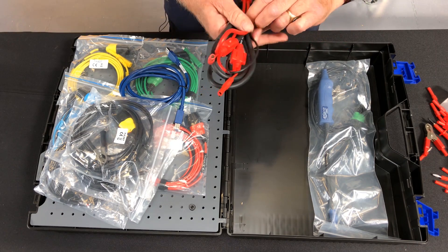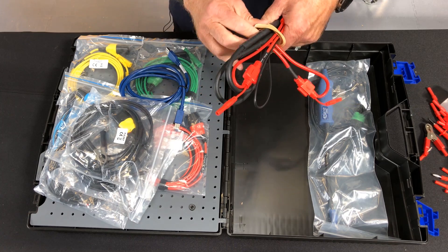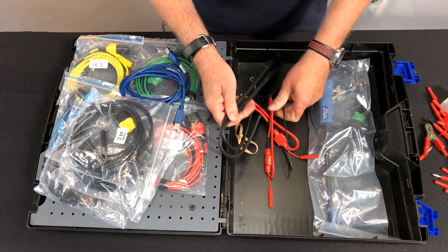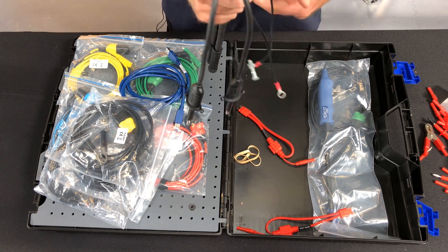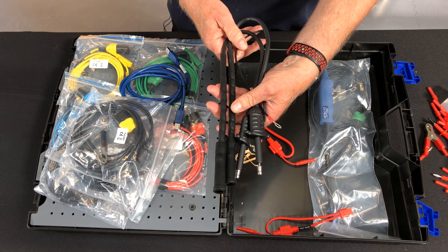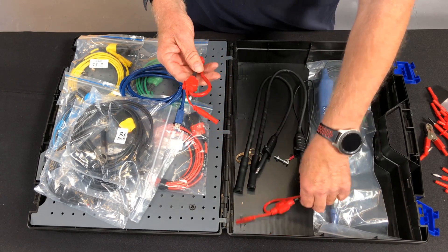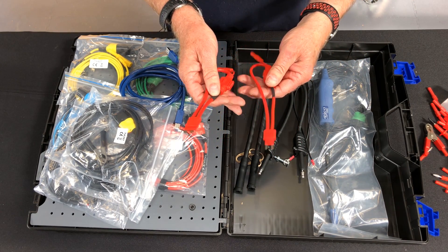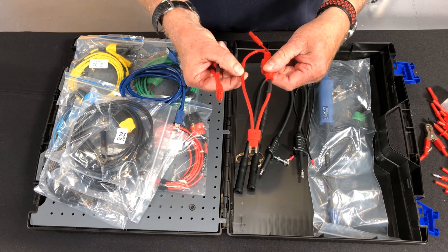Within the pile of adapters that we have here, we have two fuse extension leads, and an earthing strap which we actually connect to the coil pack when we're doing diagnostics. We also have two fuse extensions — we put this into the fuse box, put the fuse into there and put our current clamp around here.